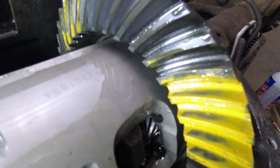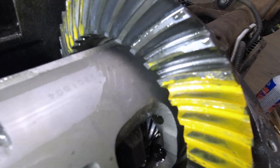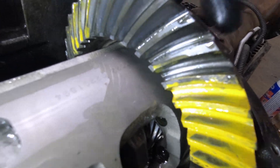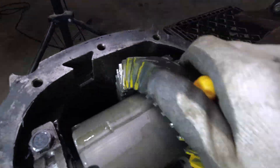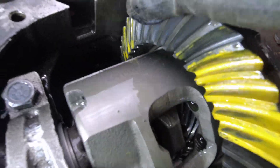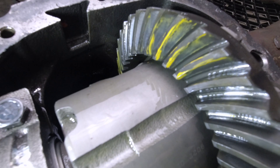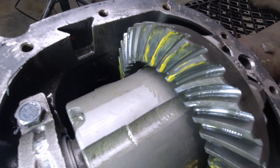I already knew that we didn't have the gears meshing right — obviously it's making noise. It's also really quite a bit looser than what it was when I first put it together. I don't know if that's normal; I wouldn't think the bearings would wear in that fast. But anyway, we'll take it apart some more and take a look at the bearings.